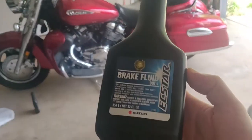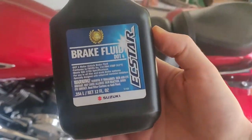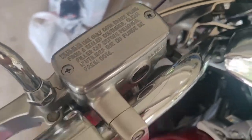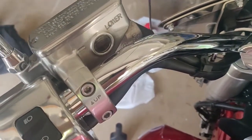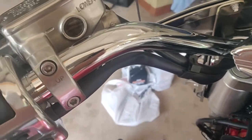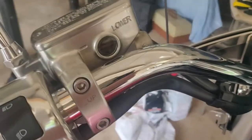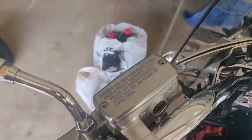This is the specific brand of brake fluid I will be using. It's a DOT4, and if you ever had a doubt which fluid to use, you can always read that on the top of the reservoir, which is where your fluid is. Take a look how burned out mine is — it's supposed to look nice and clear. This is way burned out; it's a dark brown, so let's replace it.